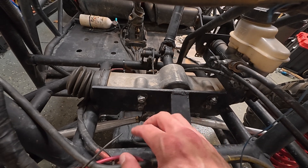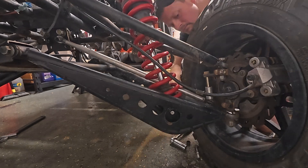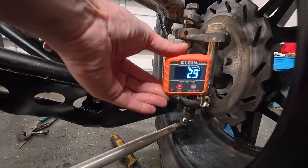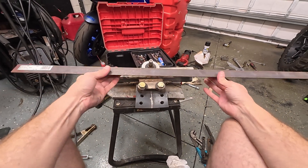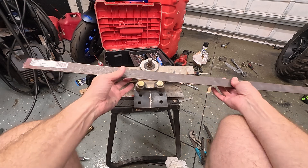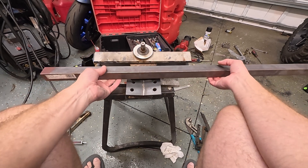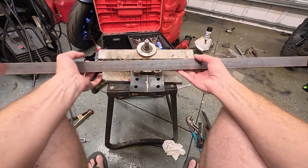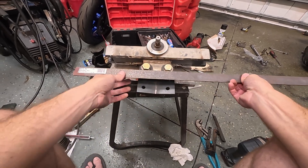I'm going to build something into this — I may even weld something into the rack here — in order to get my pivot points out and intersect the upper and the lower control arm pivots. My plan is I've got a piece of angle iron, and since my hardware store doesn't have anything thick enough, I'm just going to weld square tube right to the bottom of it. I'll cut this three-foot piece in half to get 18 inches and weld that square in. Let's get to cutting.